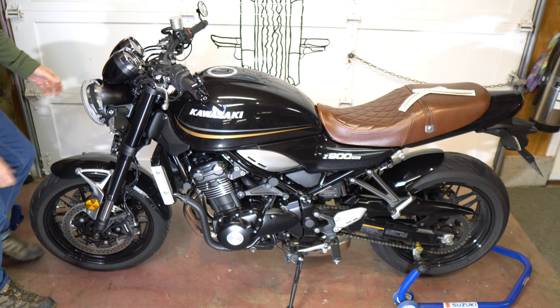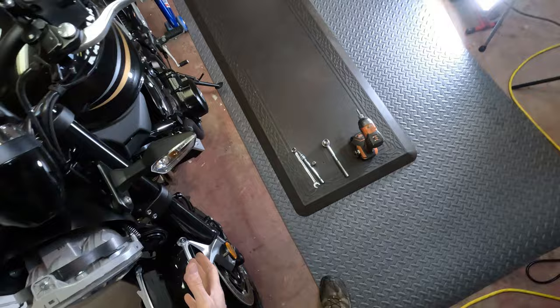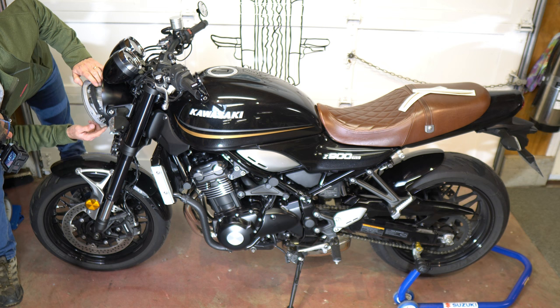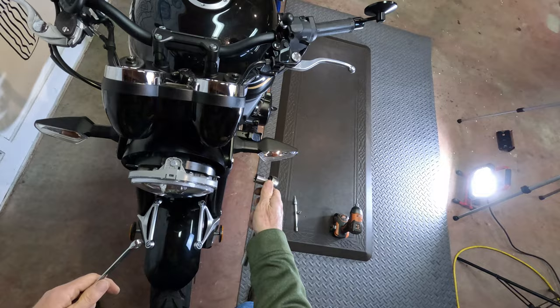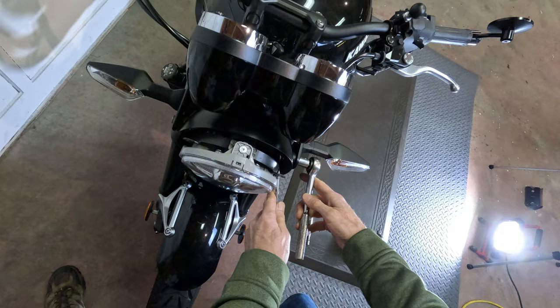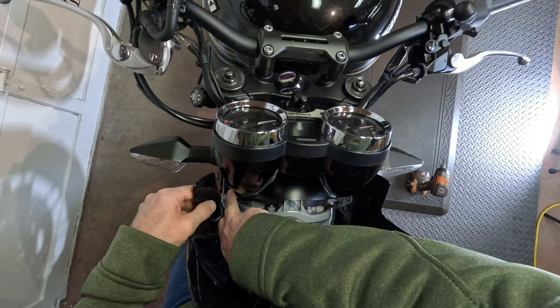I've taken off two screws down here to remove the silver bezel — that came out very easily — then four screws in the headlight rim to tilt the headlight forward. Be careful not to change the headlight adjustment — there are screws with springs on them, don't touch those. Just turn the four that sit in the rim at the 10, 2, 4, and 8 o'clock positions. Once those four screws are off, use a 14mm and a 12mm inside to start turning it out, and ease the plastic in to fit.